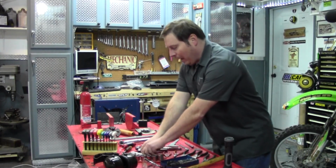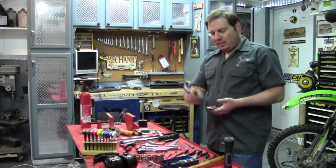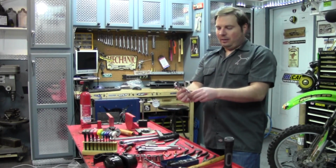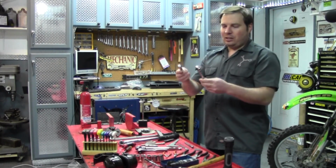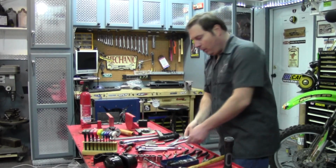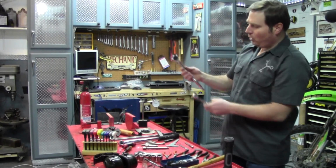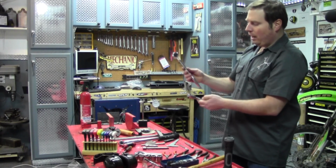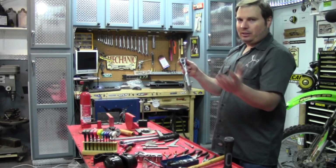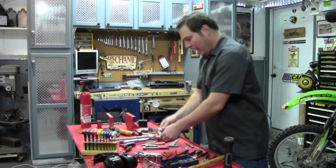And then when it comes to the ratchet, there's a lot of options out there, so this is personal preference. You get kind of more the basic one here, or you can get a little bit more fancy. It's got a swiveling head here, and just buy on these, because these are the lifeblood of the socket. You can't use the socket without this. Buy the best you can afford on these. Same with the 3/8 drive. Basic one here, a little more specialty, and obviously has a little more leverage. There's times where actually you don't want that much leverage, or you don't have room to get in there. That's typically on bikes with bodywork and things. So again, personal preference on that.